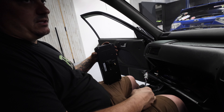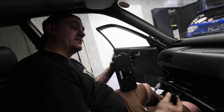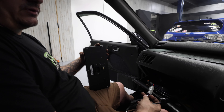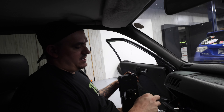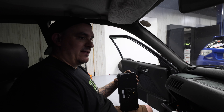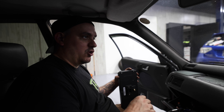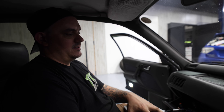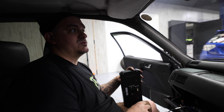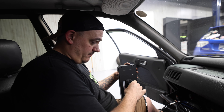It could look nice in the GT-R too. So the dash — for bare bones ECU-only data, all you need to do is hook up CAN bus. Like a lot of other GT-Rs, and the Subarus we've put the IC7 dash in, same concept: it has a plug that goes into the back of the dash, and CAN bus will relay all ECU data. There are pins that are pre-allocated and you tap into your factory harness for things like blinkers, high beam, low beam — all those lights can be displayed on the dash.